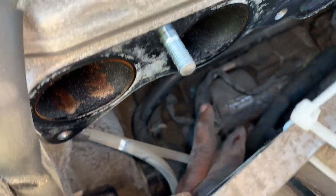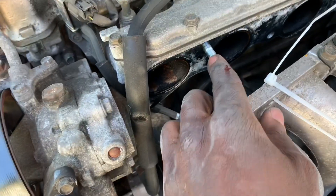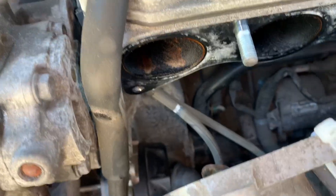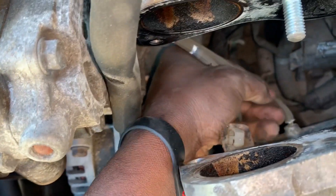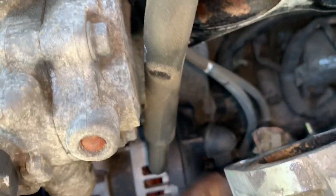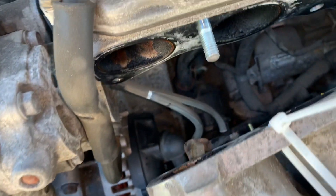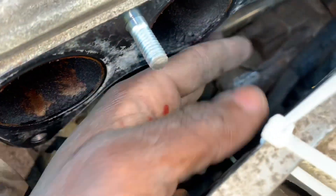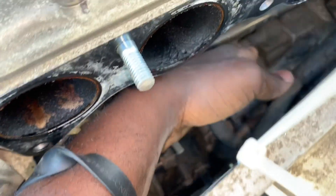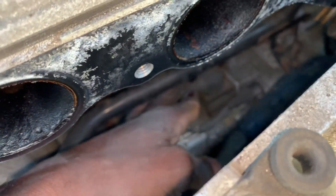After pulling it apart, you can see now I've got space to get down in here — I have access to the starter. That's the next step. Now there's a vacuum line right here, so the only thing you've got to do is just pull that out. There's another one right here — just pull that out of the way. Now we have more space. We're going to go down here and take this rubber boot off — see that rubber boot — want to take that off.